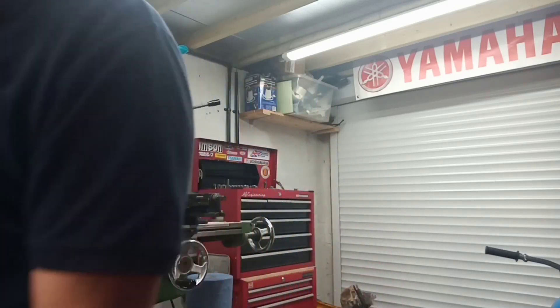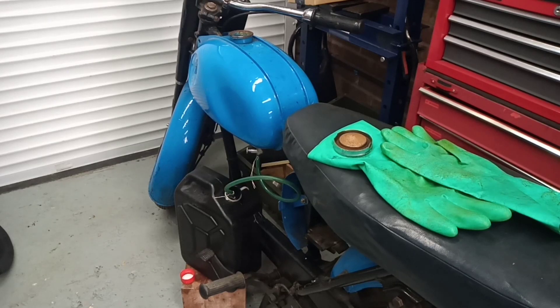We're looking at the Bantam itself. We haven't paid an awful lot of attention to the motorcycle — we've mostly been exclusively concerned with the engine in these videos. We're actually going to turn our attention to the cycle parts now. You can see I've got a drain hose attached to the tank going to an oil drain container and I've been draining out the old fuel. You know what old fuel is like — it was absolutely stinking. It's pre-mixed so it's left an oily residue, and the tank has got quite a bit of surface rust inside.